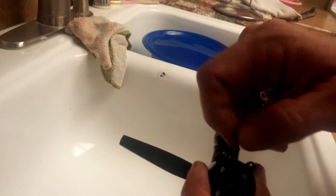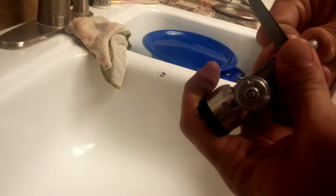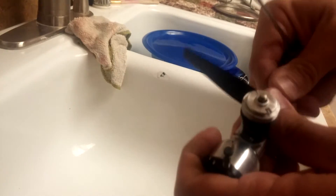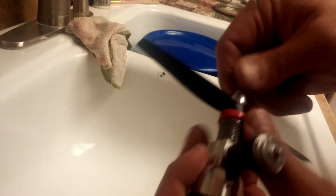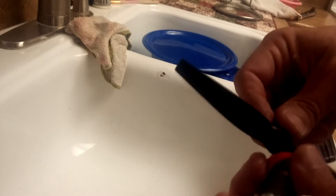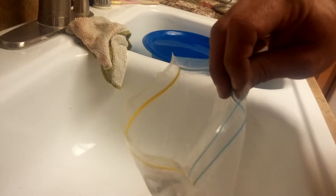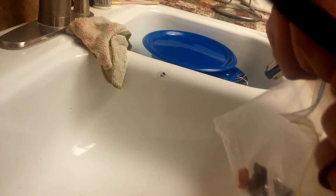Now that we're well oiled, put the needle valve back in. I close them all the way, because whenever I get ready to run these I just assume they're going to be closed. I'm not going to store it with the prop — just in case I crash a lot this week and need a bunch of props. At this point I would say this engine is ready to go. We're going to put it in a regular Ziploc bag — I'll keep the spinner in there, but not the prop.